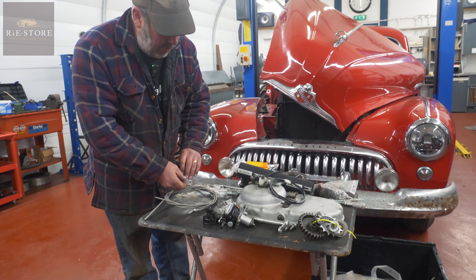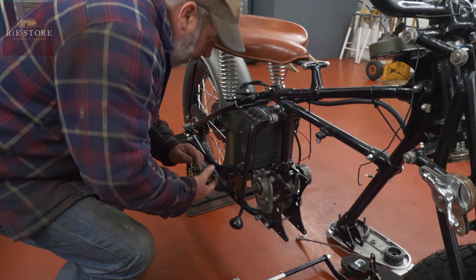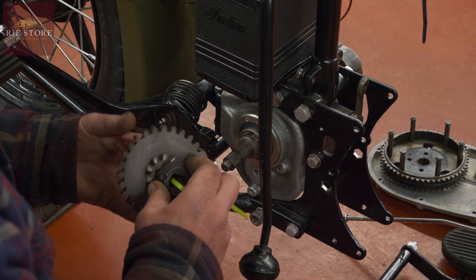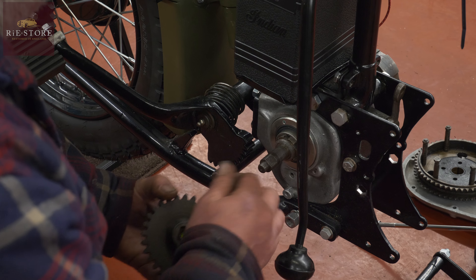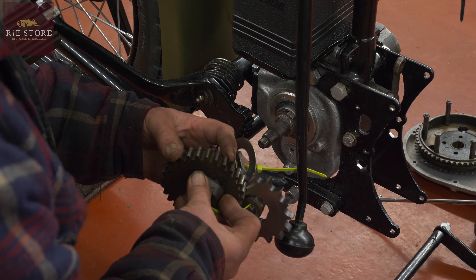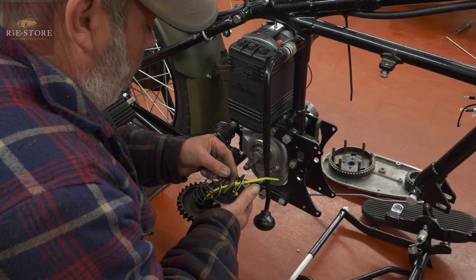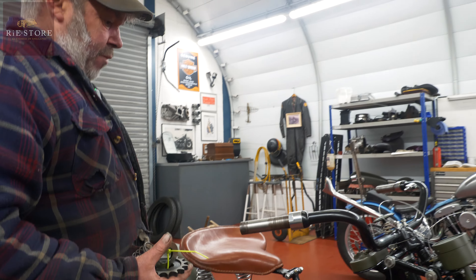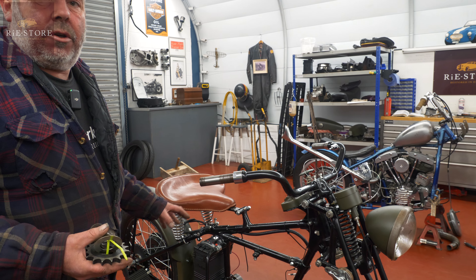You've got outer cables, gearbox shims, clutch nuts, stop lamp switch, kickstart, and rear drive chain — that goes on that side of the gearbox. That one with your teeth there goes on there first, then you have your spring-loaded kickstart quadrant. That's the very distinctive noise on an Indian — it's square cut, so that goes on there on that square cut and it's spring loaded back, so when you kick it that will rotate the engine and it just turns back on its own. There should be a lock screw that goes in there with a tab washer and lock nut.